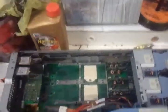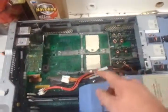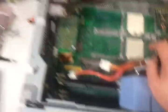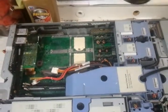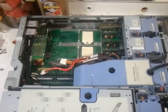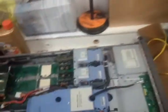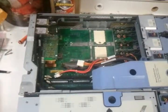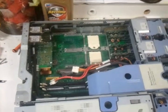What I'm going to do in the meantime is pick up a $40 Itanium processor — a 1.5 or so dual core — and stick it in there just to get the system running. I think I've got to go with CPU 0, and then I can install Windows and Linux. Be wary — you do have to get a special version of Windows and Linux. I have old MSDN disks for Windows Server 2003 for Itanium systems, Service Pack 1 and 2.